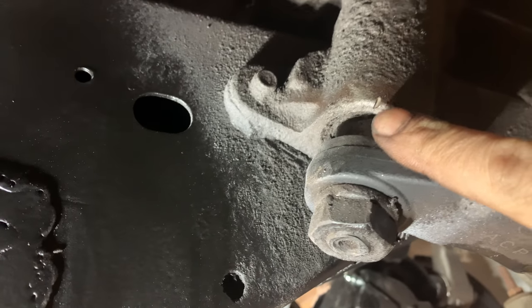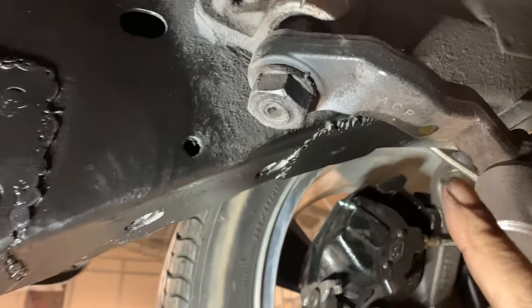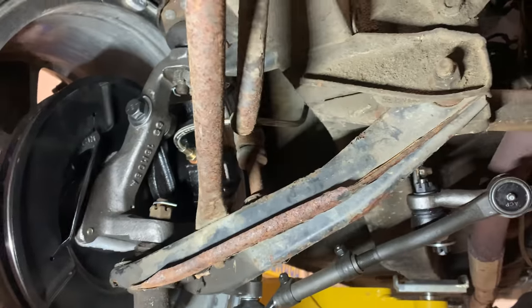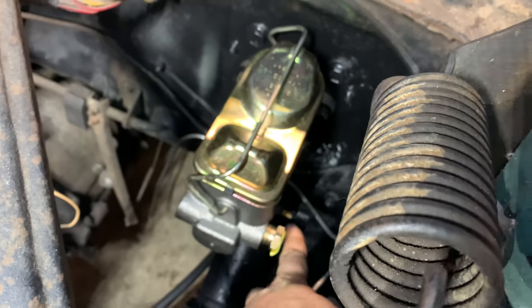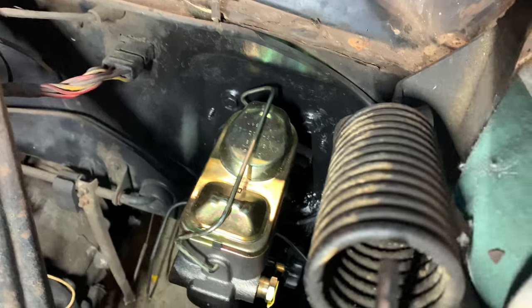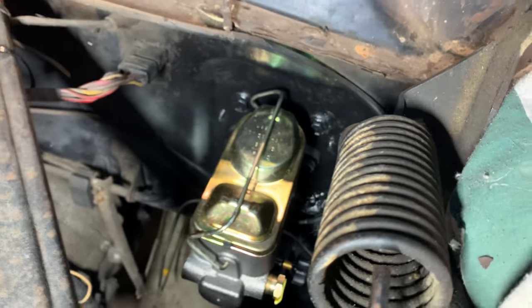I had scored the steering rack where the pitman arm goes in, so I knew exactly where to put the new pitman arm in. All of that is in there as it's supposed to be. I just have to hook up the fuel line and make sure everything else is good. Next we mounted the new master cylinder, which has two reservoirs in it and also has a proportioning valve down here if you want bias to the back or the front, so we can adjust that once everything's in. The pedal is connected on the other side with the clips.